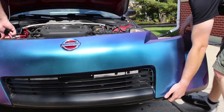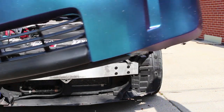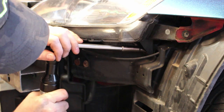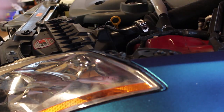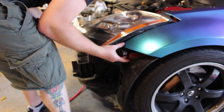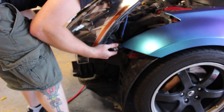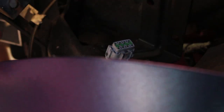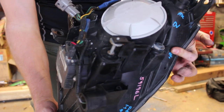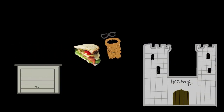When I got over there, the first thing we did was pull off the front bumper to see exactly what we were working with. With the front bumper off you can see the brackets and the screws that hold the headlight in place. As we dislodged the light, we pulled it partially out and gained access to the wiring connector on the back. It's a little fiddly — you've got to get in with a screwdriver or small fingers and try to undo the clip. Once you get the weather pack apart, the headlight itself comes straight out.